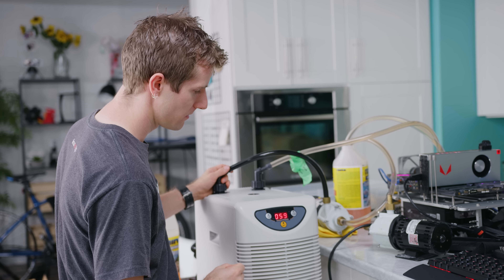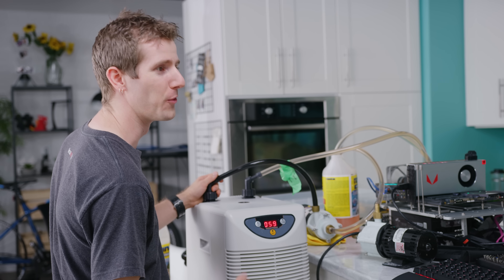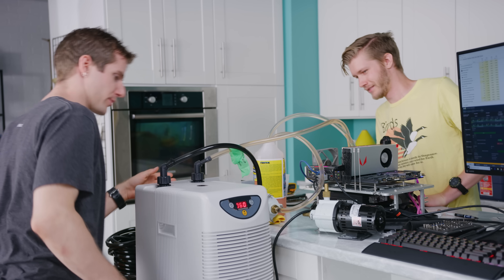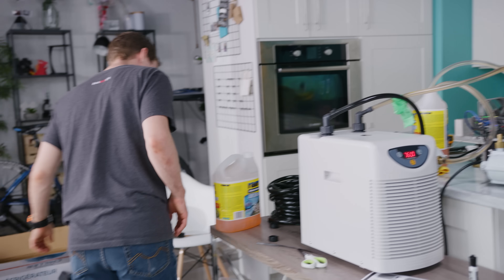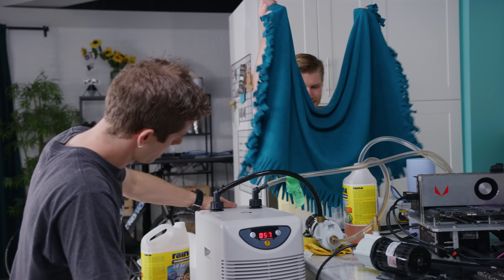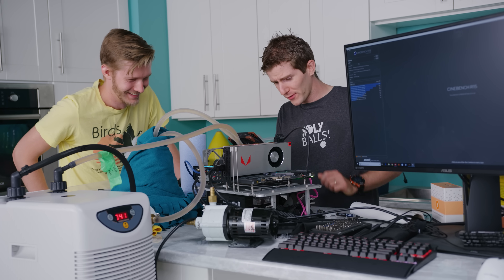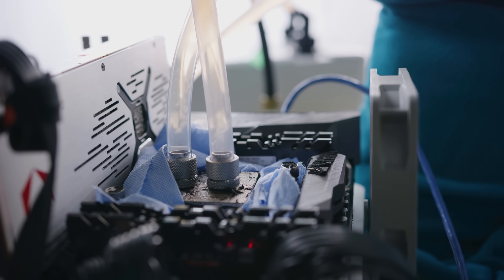I think we should do chilled. Like, we've already screwed up that motherboard, so what do we have to lose besides time? The CPU. We have another one. The RAM. We have more. We'd never recommend that anyone run below ambient or below the dew point on an ongoing basis without protection. But we're just doing a Threadripper 2 overclocking experiment. So we'll just put some shop towel around the socket. This is a really bad idea. Even with all this airflow over the CPU socket area and the VRMs, our block is still sweating. But on the plus side, our CPU is idling at about seven degrees.